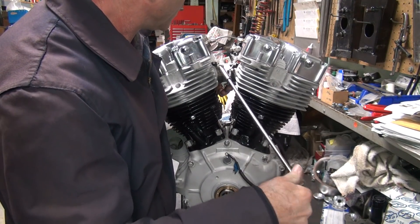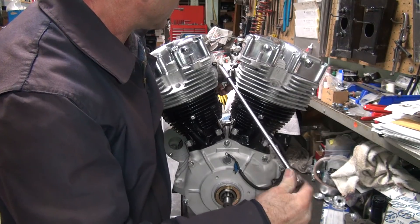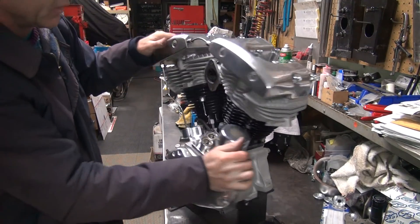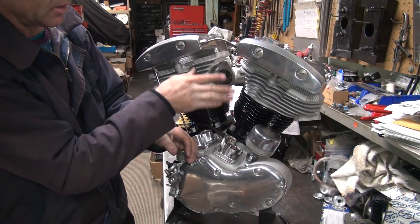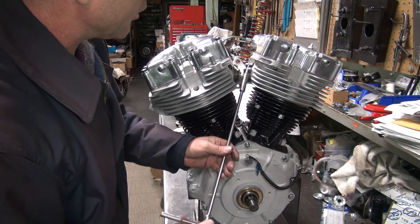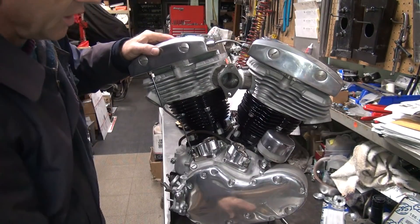In this clamp, you can move all the way up until it hits the head. Put a little torque on that. As I'm torquing that one, this one is pulling in closer too because it's pulling the whole manifold in. Go over here and give it a couple taps just to kind of center it. Rock it up and down — up and down gets it centered, and tapping side to side pushes it in. Just light bangs. Come in here and get the bottom one. Put a little torque on it. Come over here and do a little torque on this one. They're about equal — tap it again. Each time you're doing this you're self-centering it.